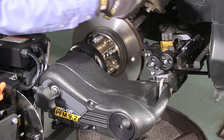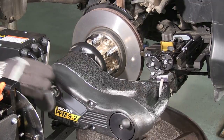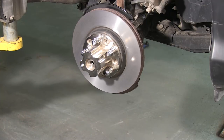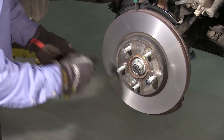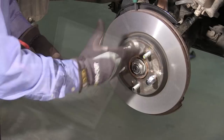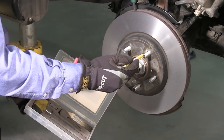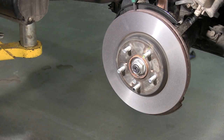When the cut is complete on the first side and the lathe is shut off by the stop cam, carefully remove the lathe from the vehicle by loosening the drawbar. Use caution as to not crash the cutting tips into any parts of the vehicle as you remove the lathe. Now either install at least two nuts on the rotor you've just matched on the first side, or index the rotor to the hub with the crayon from the toolbox and remove the rotor to make sure it won't fall on the floor. If you don't take this step, then you will undo the perfect rotor hub match you just created.